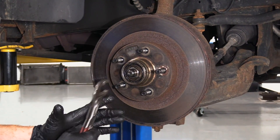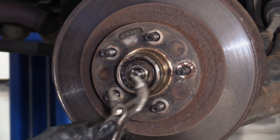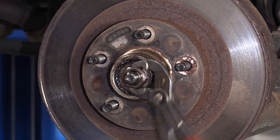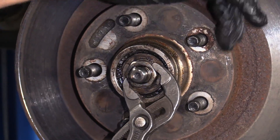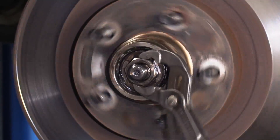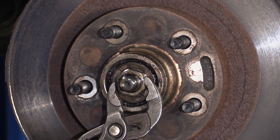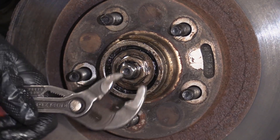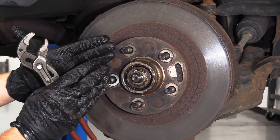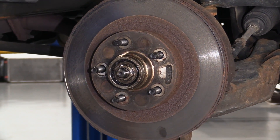If you're just adjusting your existing bearings on the fly because you noticed they were a little loose, take your pliers and just turn the nut back and forth — that helps push out any air that might be in there, which is less likely than if you just replaced the bearings. Give it a spin and keep doing this. You only want to go until it bottoms out — don't grip it and try to force it past that. We just want to make sure the bearings are inside the rotor and the rotor has no movement. This feels great, so let's continue.